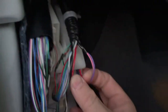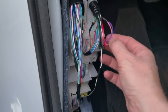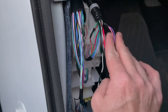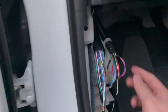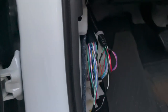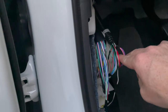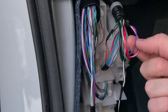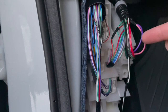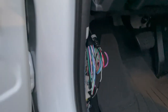I know this won't be comfortable for most people, and I haven't been able to find a connector for this, but it's not too big of a deal — I'm just going to snip these right here and crimp some spade connectors on so that if I ever need to revert to factory I just pop them back together. You could also use a wire crimp. Once we cut these two right here, we take the output going to the door and route that to the amp's left output — that will feed the door speaker.